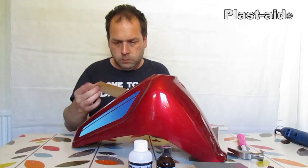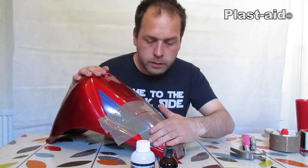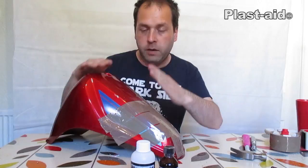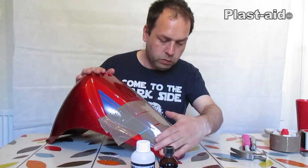Make sure you take some care when you're putting the tape on to get the edges to line up properly. I've taped up the repair making sure that I've aligned all the plastic so none of it's overlapping or any edges are sticking out. When you lay the tape on, do it gradually and carefully like you're applying a decal — just take your time with it, make sure it's all lined up. If you have to do a second layer of tape, just make sure that everything is held in place.